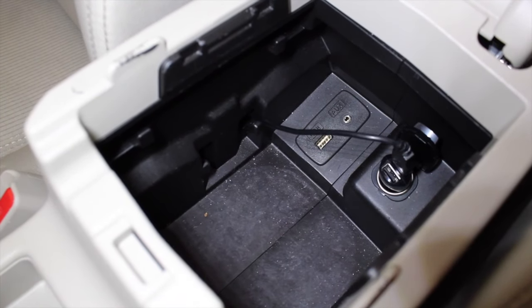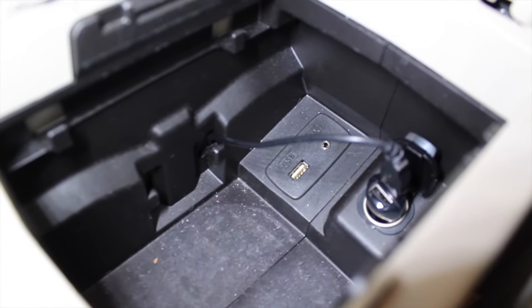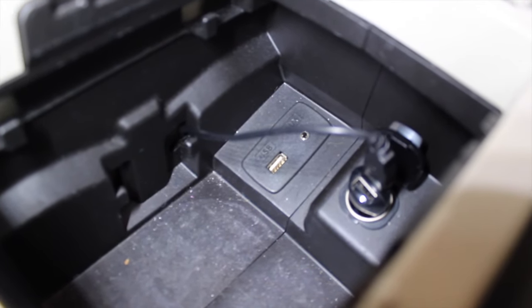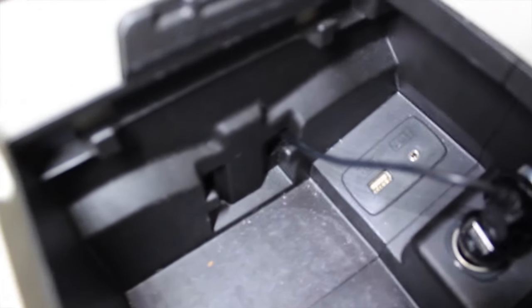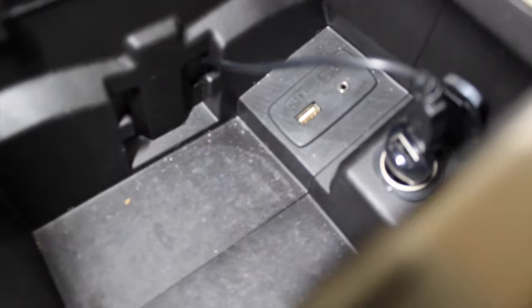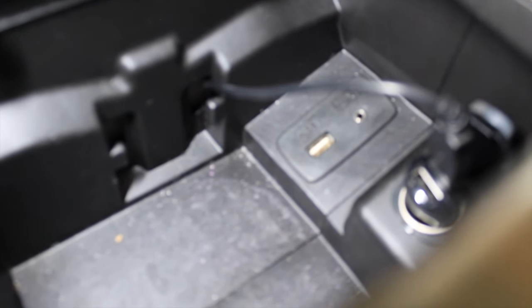With this car specifically, I ran it to the center console. One thing I didn't think about was how to enter the center console and the easiest way to do that. I ran it from the dash cam out to the back area because I didn't want a lot of extra cord hanging down in my rearview mirror. The problem I ran into is there's a little tiny spot on the side to get the wire through, and it was really hard to get the wire up into that location from the side of the trim. If I had run it from inside out toward the dash cam, it would have been a lot easier to poke it through that hole. Make sure your wire ends can get through where they need to go.